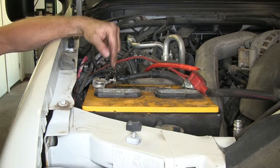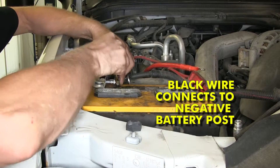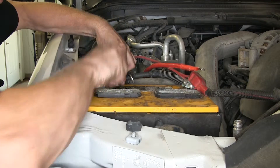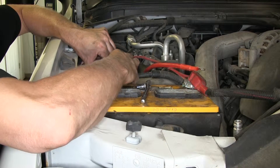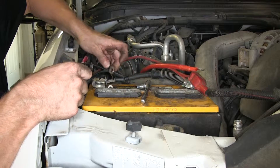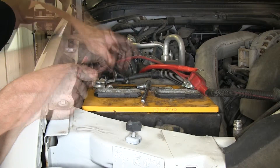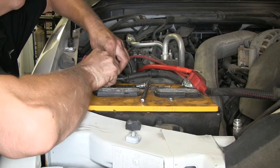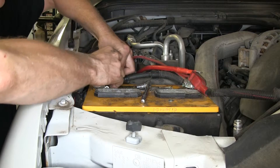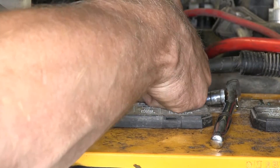Now we're at our battery, we'll go ahead and connect up. First we'll do our ground — black to black. We'll loosen up the clamp here to make our connection. We'll take our wire and bolt it right back into place. Now our loop is going to be way too big for this bolt, so we're going to have to use a washer to help take up some of the slack. The flat washers we're using are size number 10 — small washers that happen to match the bolt — to get the most contact on the ring terminal for the wire.